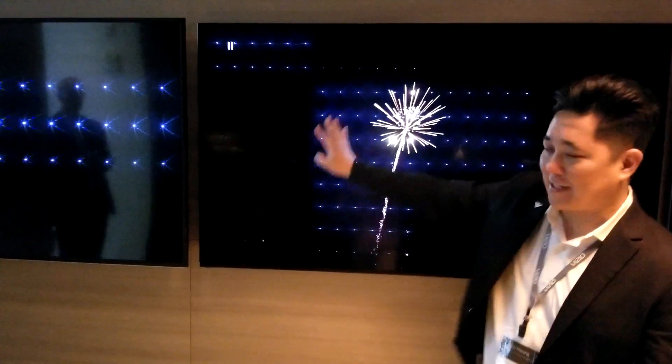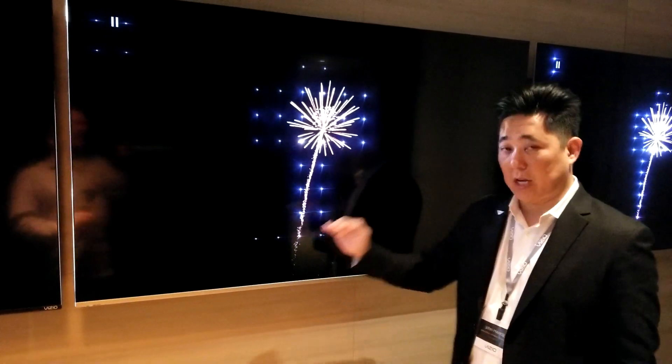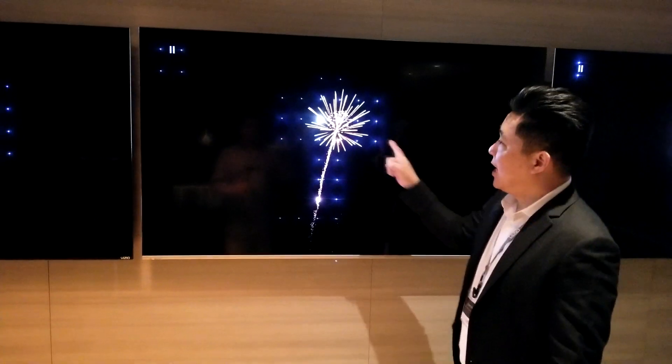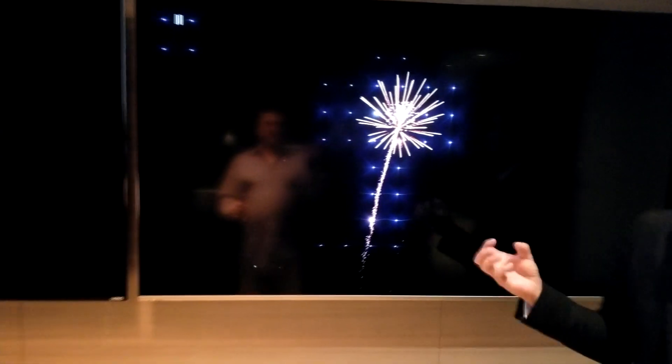When you have the entire optical stack in place, you're not going to see the LEDs, but we can't go too crazy on peak brightness because you will get blooming. In P series, we have 10 columns — so 10 rows by 10 columns, giving the 65-inch set 100 zones of local dimming and peak brightness zones as well. As you can see, this firework is much tighter, and even the pause icon is much tighter. Since we can control those zones more precisely, we can go more aggressive on peak brightness without showing too much blooming.